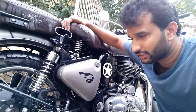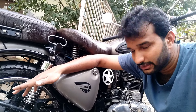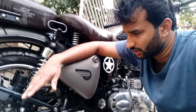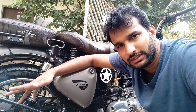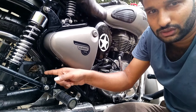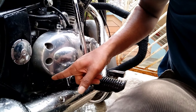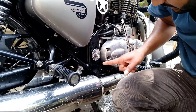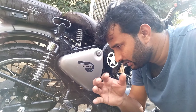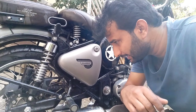This is how you can clean your chain by using diesel. I cleaned it with diesel and later I washed the complete bike. If you don't want to wash it, you can just use the diesel and the same technique I have shown to clean it. You can see there is no stain here. The complete chain is clean and the inner part is also clean. I have removed almost 90% of the grease and dust which was all over the chain and engine part.